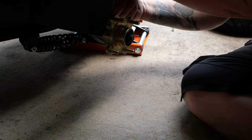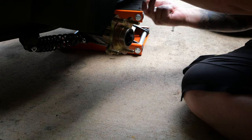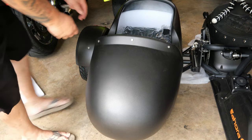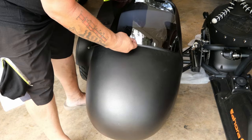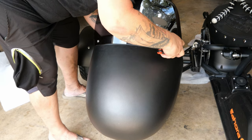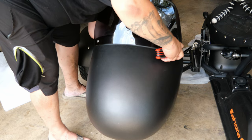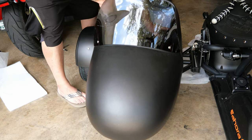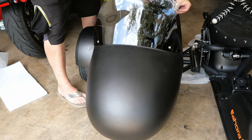If you've got a four millimeter ratcheting hex bit, that's probably the way to do it, but I don't have that. So put the windshield on, take the remainder of the plastic off, and we're going to take this baby for a ride. Last step before we air it up and take it for a ride — we're going to pull these little guys out. They come pre-installed. You need a 10 millimeter on the inside and a four millimeter hex bit on the outside. Tighten those guys up. I don't want to pull it too tight because this is just a plastic-based windshield — you can do some damage if you overdo it. Pull this plastic off the seat. We got her all put together. I've got a lot of trash out here from the packaging. I'm going to get cleaned up, and next we meet we'll be back on the M1 PS, all aired up and ready to ride.